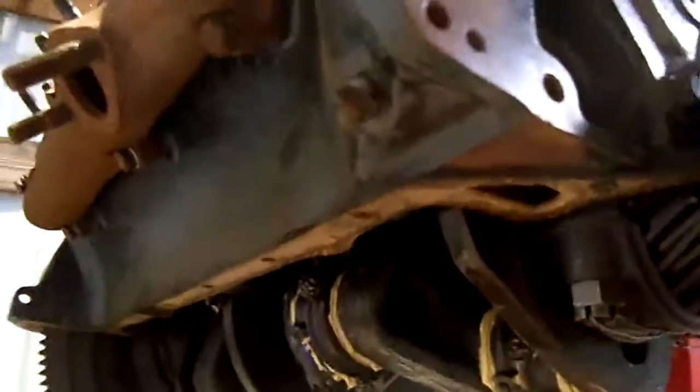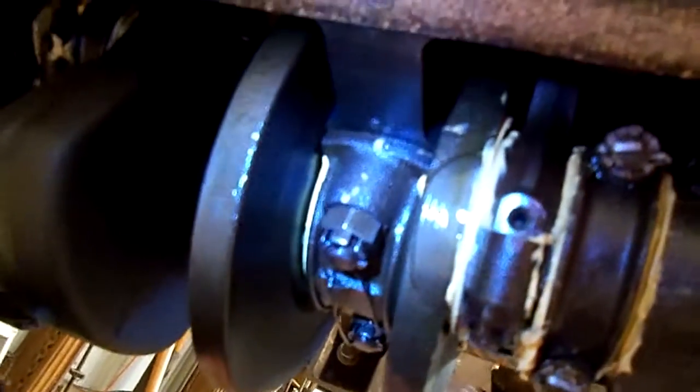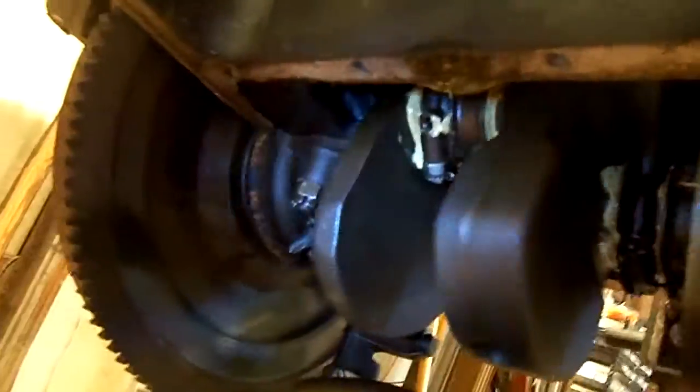No water pumps on it — I don't have any for it. You can see that underneath here this has all been torqued, no doubt — greased and ready to go. I'm going to flip it over and pull off one of the main bearing caps to make sure it's got insert mains and not the Babbitt poured type, because you want the insert type. I have yet to verify that — I'll be doing that next.